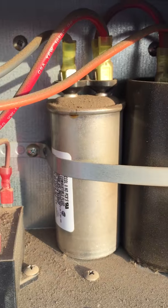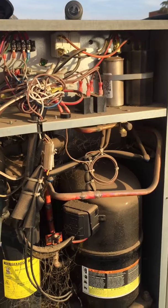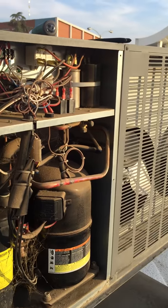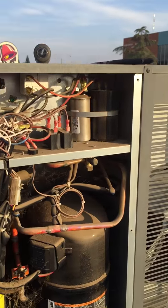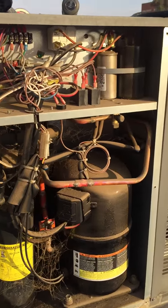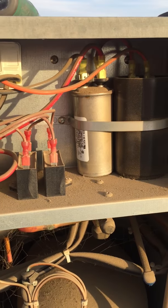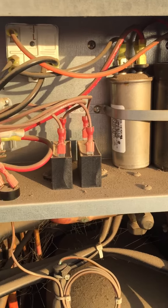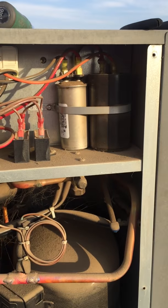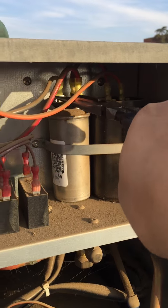See the silver run capacitor — it's swollen. It's working right now, but the problem is that sometimes it doesn't work: the bins are empty, no ice, and it beeps three times. So you have to reset it. It comes back on, makes some ice, and sometimes doesn't work as well. That's what I'm working with — you gotta short it out.